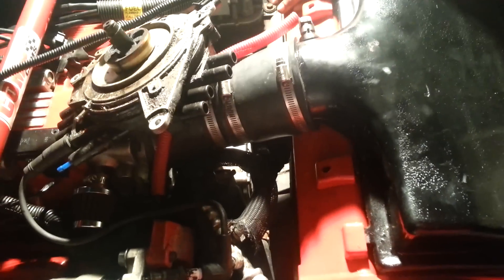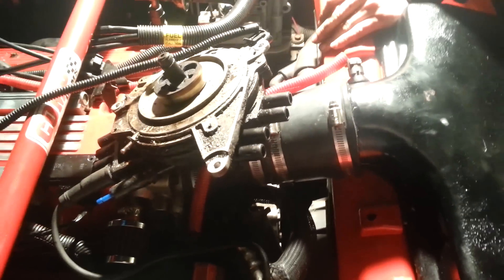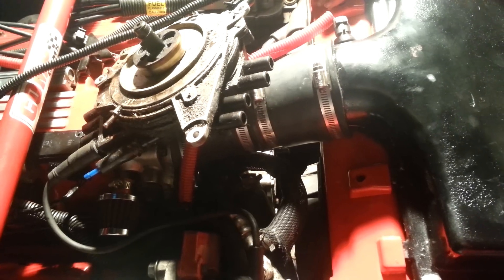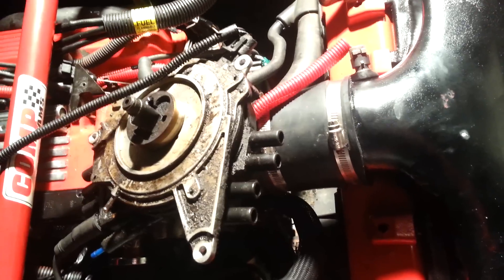I'll revise this and try to figure out a way to test them without having an LT1 vehicle, but I figured I'd share this to help some of you out there with this problem. Now I know I have a spark delivery problem from the cap out to the cylinders. I'm going to try swapping the distributor cap from this unit onto mine. The vented OptiSpark cap will work with the non-vented OptiSpark, as long as you have the non-vented separator piece installed.